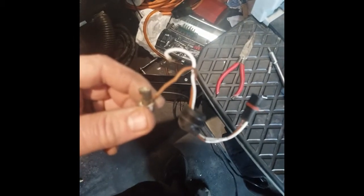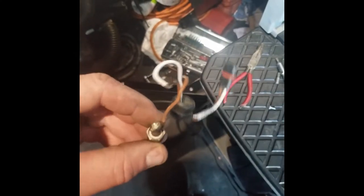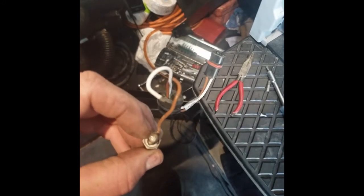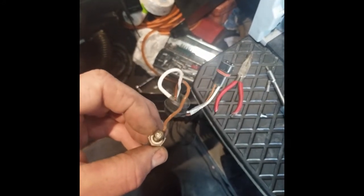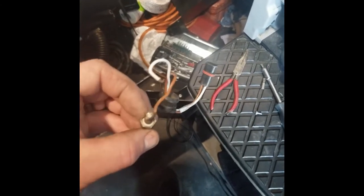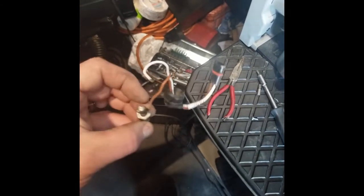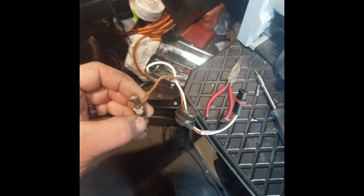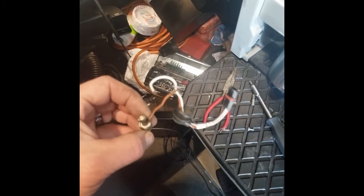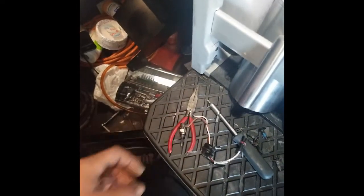I think I did slide the grommet off — nonetheless, you could easily break the ceramic on the inside trying to take it off. You want to make sure everything's going in real square. These are not in super tight, so it should be relatively easy. And then as you're twisting it out, the wire leads are going to want to get caught up on everything and tangled, so just take your time and free those up every half turn or so.